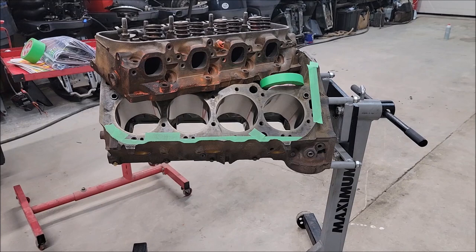I'm in the middle of masking this engine — I'm not really videotaping this part because it's a very boring job; it's easier to just blast music and avoid the commentary. But I just thought I'd stop in real quick. What I'm doing is using the parts that are going on as a guide for what I'm masking off, so I won't have any unnecessary exposed parts. Essentially I'll put the tape under, then put the part over that and cut around it. Hopefully it's not interfering with the gaskets, but you're also not going to see exposed metal.